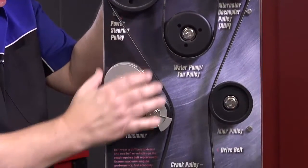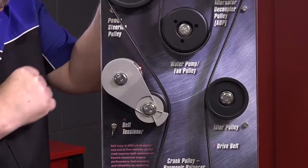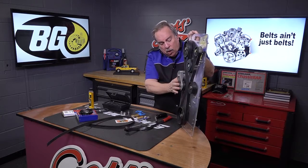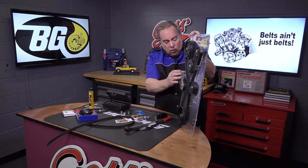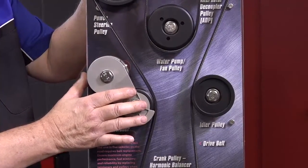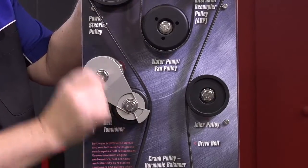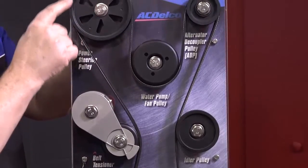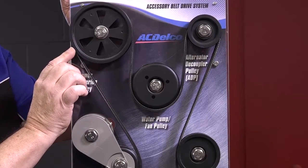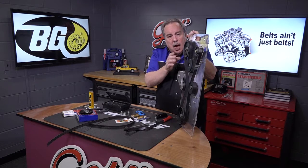The tensioner spring will go bad and when it does it doesn't keep enough tension on the belt, and the belt will screech when you first start the car or sometimes when you accelerate away from a traffic light. Another common problem is where the various pulleys that control the positioning of the belt wear and change position, so the belt rides a little bit off to the side of one of these pulleys. As the belt comes around the pulley it rides up on the edge a little bit and then slips down into the grooves — every time that happens, you get a chirp. So this chirp chirp chirp is frequently because the belts are not properly aligned.